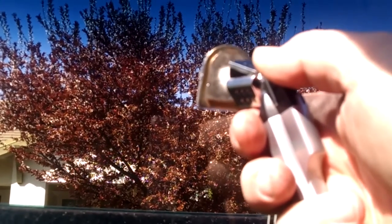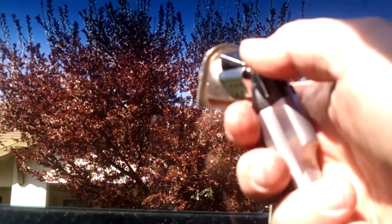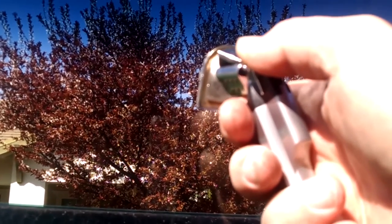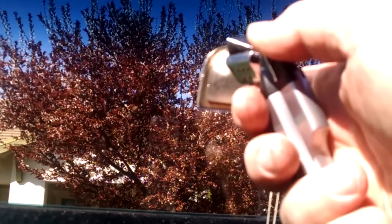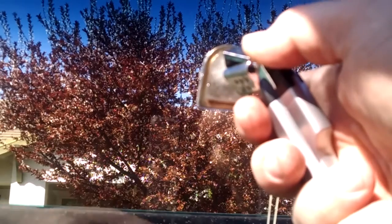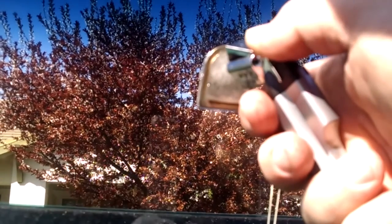The heat makes the mount come off easily; otherwise you risk damaging the windshield if you try to force it out. Alternatively, you can spray the area around the mount hardware with dish soap or detergent to weaken the adhesive, which is safer than applying heat. Note: only remove the mount from the windshield if you are replacing the mirror with a new one that has a new mount bracket. Otherwise, it's easy to remove a rearview mirror from the mount bracket — simply unscrew it or pull it upwards.